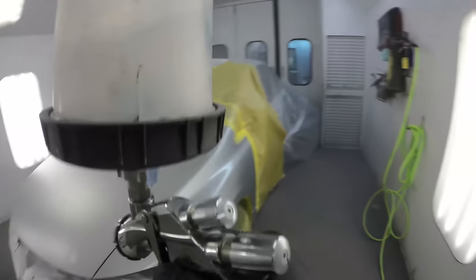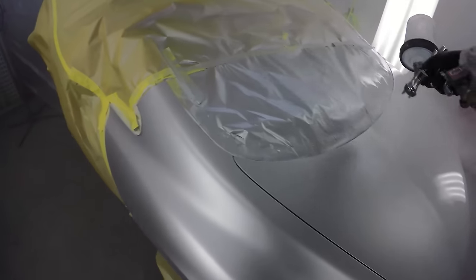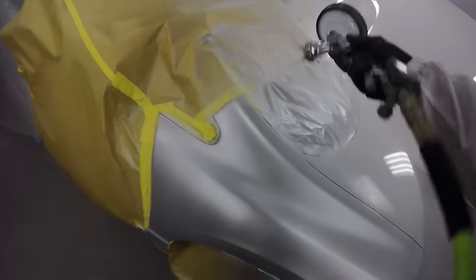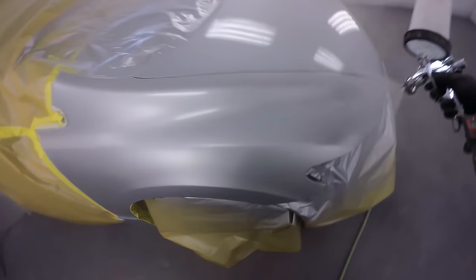When applying clear coat it's more crucial that you have a good pattern. I'm letting up on my edges to minimize the effect of changing the color on the edge of the fender — a big pile-up of clear at the end of the fender will magnify the color bed and change it. You want to have a plan: know where you're starting and stopping, and do it sequentially. That edge is drying quickly and you want to keep it wet as you go. On a complete vehicle you have to plan where you'll have the minimal wet edge exposed on your starting point.